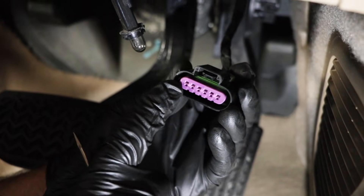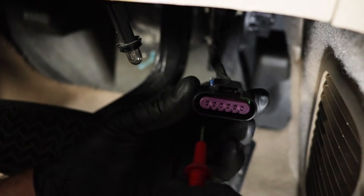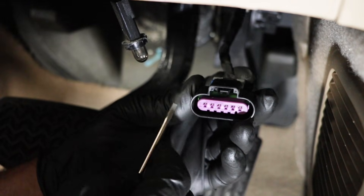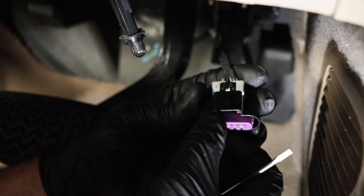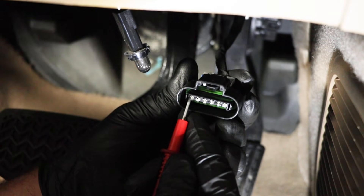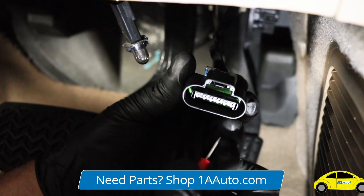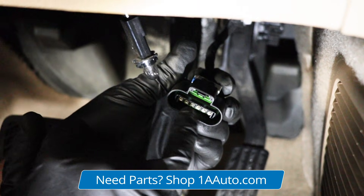What I want to do is take the cover off this connector before I test it. I don't want to push my meter lead through any of these slots here — you're going to spread the cover and possibly ruin the terminals. Just take a small flat blade tool and slide the cover off. With the cover off, I can just touch the test lead to one of the terminals without pushing in and spreading them, which would ruin the connector terminals.